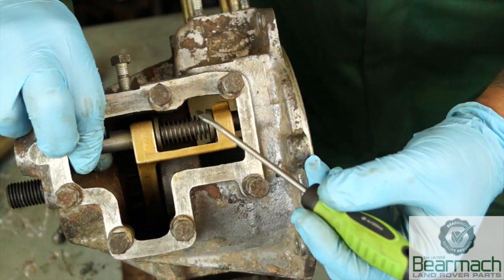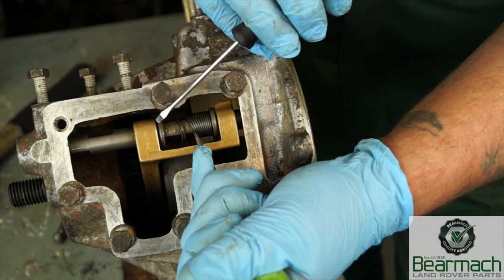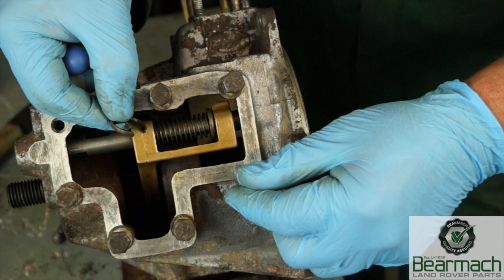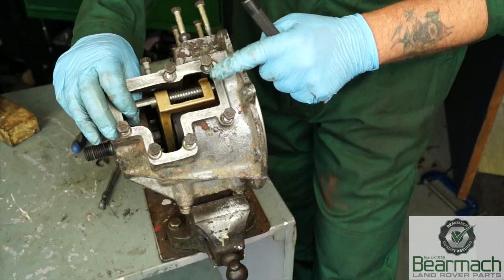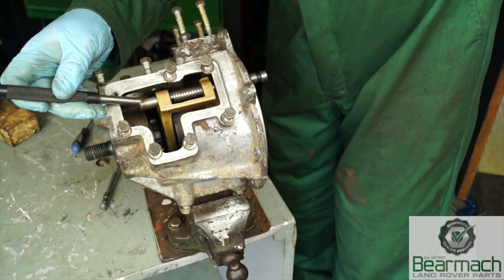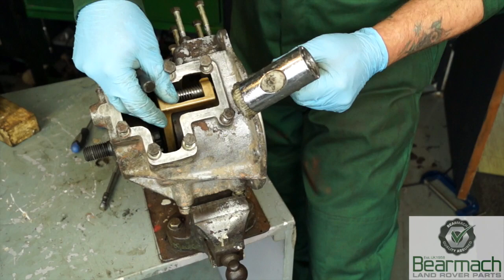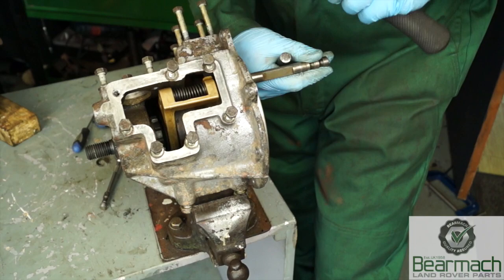This is an allen key size. Once that's been removed you can pull the spring back — this might be a little bit difficult but you use a screwdriver, hold the spring back, and then lift out the clip. This is a slotted clip; both clips will need to be removed first in the same manner before you can remove the shaft. The selector shaft comes out of the back of the housing — it may be a little sticky but once the detent is removed you can tap it out. Be careful that the ball bearing doesn't get caught in the grooves of the shaft.